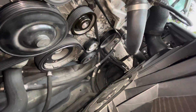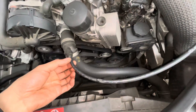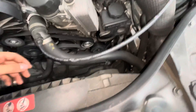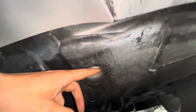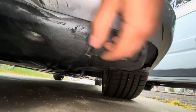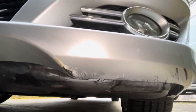The other side is a little bit tighter. You're really just going to have to stretch all the way around this hose, or kind of push it. You want to be very careful because this likes to break, and so does this — I'd avoid touching this at all. You can of course remove this, just be very careful. There's also the option where you can try and remove bolts like this one — some vehicles have this little cutout with swivels on it and you can lean this out — but mine's solid. You might want to take these bolts out and lean the belly pan down a little bit so you can get in there if you've got bigger arms.